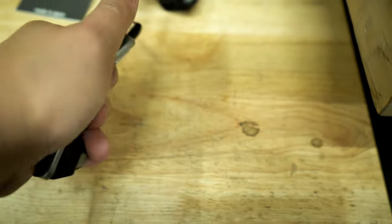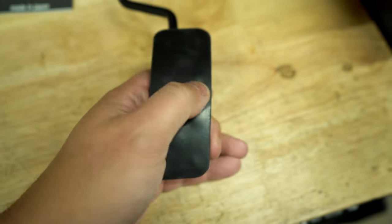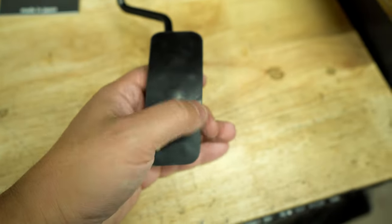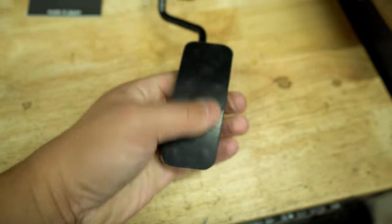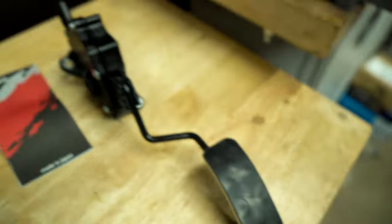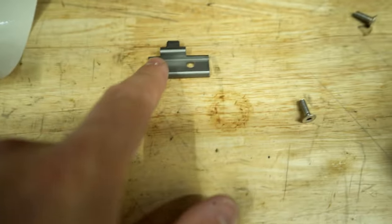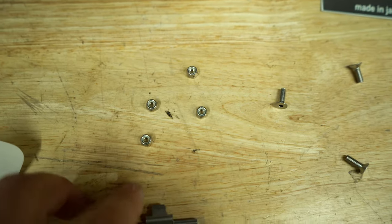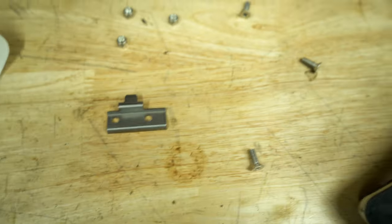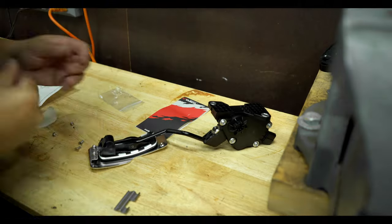We put it on, I'm just gonna continue to press down so we can adhere properly. And yeah, you can see how it's kind of bulging out. See those little divots? That's from before. So yeah, let's put this on. I'm gonna press it down off camera so I might sweat a little bit, and then we'll be good. So pretty much what's gonna happen is these brackets are gonna sit behind the pedal here. This one and this one are gonna use these tiny little screws that I always tend to lose, knock on wood, to basically clamp this down. So let's do that. Then we're gonna install the pedal spacer afterwards and the stopper, and we'll go for a drive and see how much of a difference this really makes.